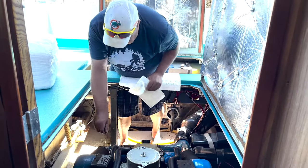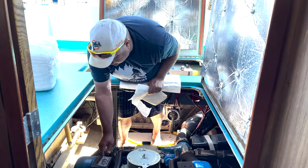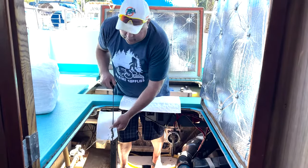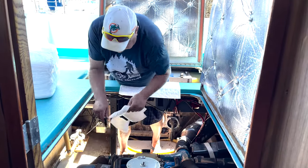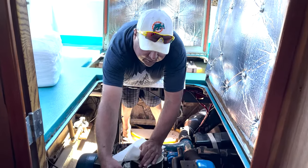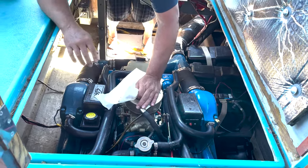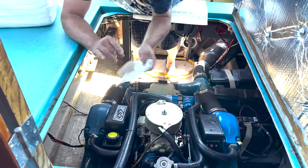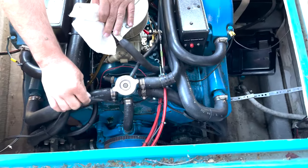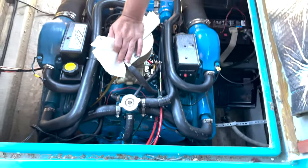We do have enough oil. Check your water, got a coolant — give a visual inspection, check your belts, make sure you got nothing dangling in there that can get caught up. Get that wire, but it's strapped down.